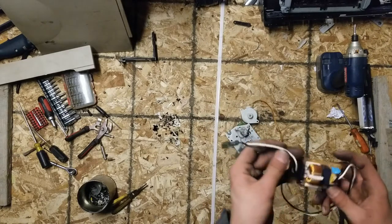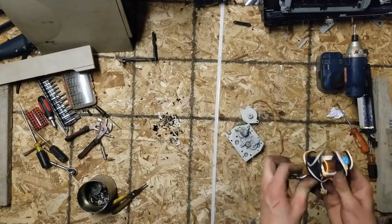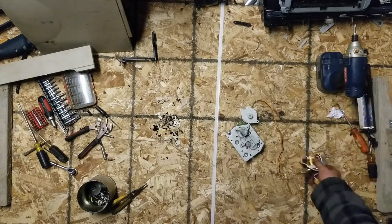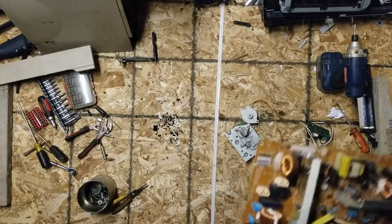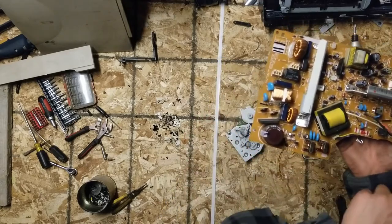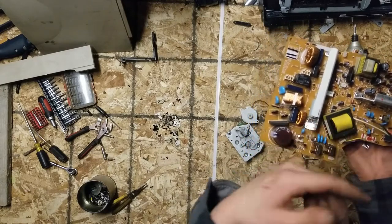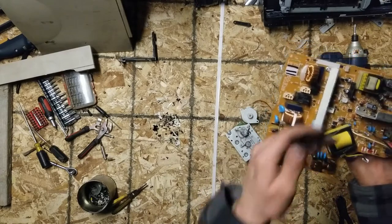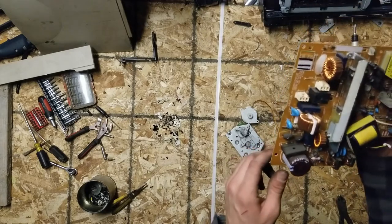And it looks like this big line filter rectifier module here, taking the line in and taking it DC out. And from there, it goes to the main control board. That's why we were seeing so many of these transformers on here, because this board actually takes in the full line voltage rectified, and deals with its own switching and voltage dropping here at the control board.